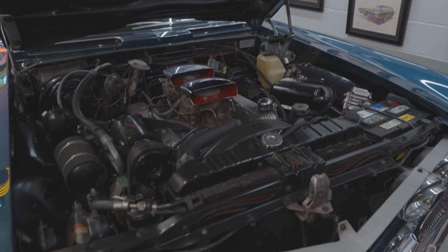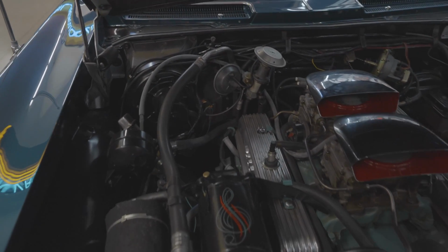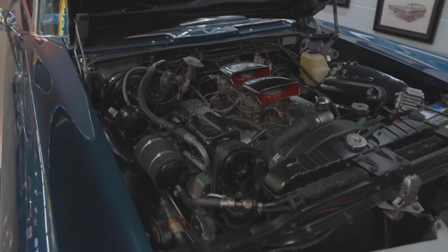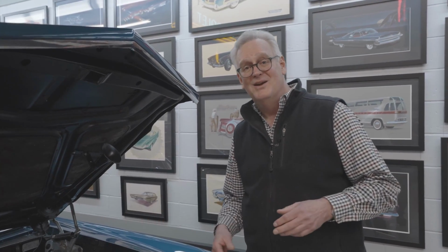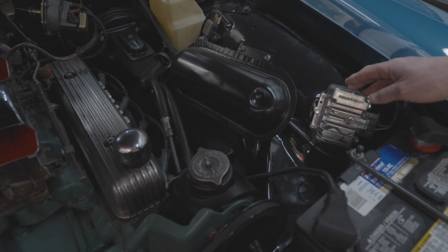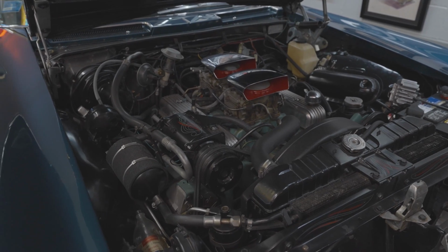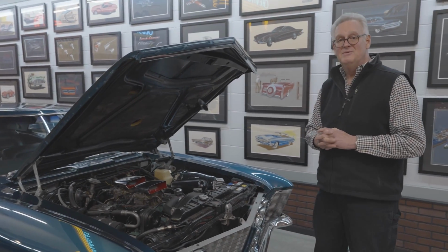The people at General Motors knew that anybody driving this car would have the air conditioning on, and you can see all these hoses, all of the air conditioning controls work with vacuum. And so what would happen is when you stomp on the engine and those 2 carburetors open up, you'll lose all your vacuum. So the good folks at Buick had the idea to put a vacuum reserve tank on, and that would keep the air conditioning running while you're stomping on your 2 4-barrel carburetors. It also has this heavy-duty voltage regulator. It was like a police voltage regulator, completely solid state. And we did a beautiful restoration of the car, have driven it all over the East Coast. It's a really fun car to drive, and it handles beautifully just like it was intended to.